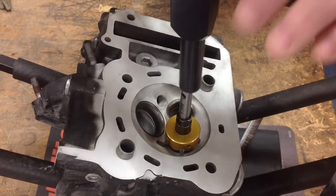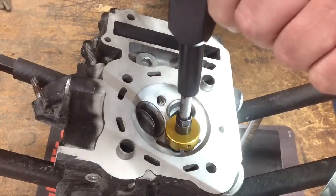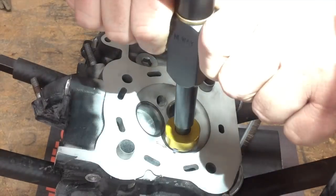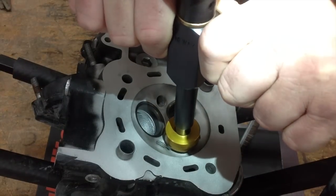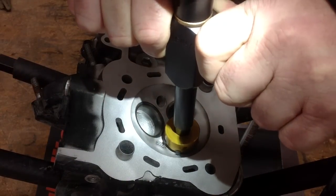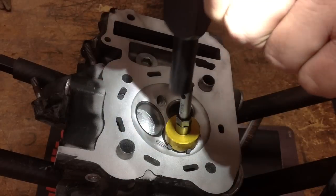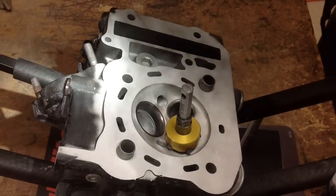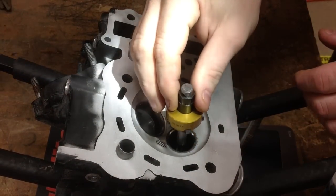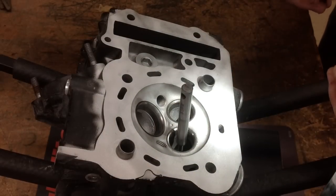Go ahead, Ross, you can start. Now he's starting to put pressure on it, and then he'll dwell, and then pressure off. He's going to swing the drive motor out of the way so that it doesn't bump the cutter head and give him an opportunity to drop that — because remember, if you drop that, it will put marks in the seat.